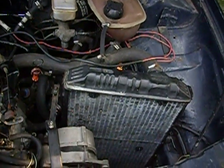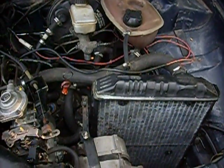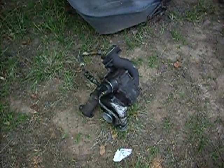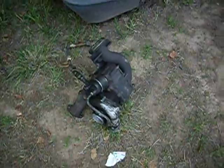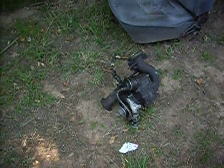We did have to make one other major modification to allow for the engine to be set in. There's the concession we had to make — that's the turbo that made the engine a turbodiesel. There was a space constraint in the Jetta; it was impacting the frame and just wouldn't fit. So we had to lose the turbo for now until we can find some way of modifying how it's mounted. Right now it's an 88 Volkswagen Fox non-turbo diesel.